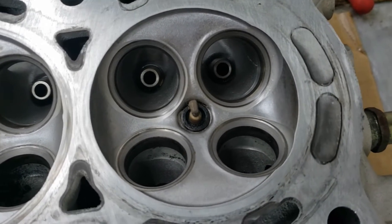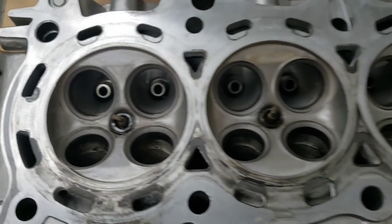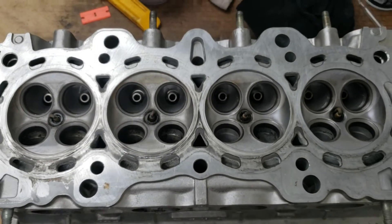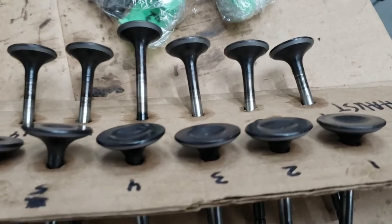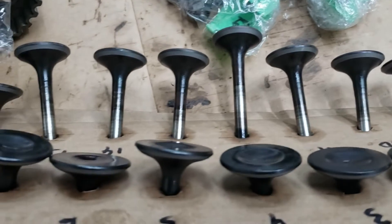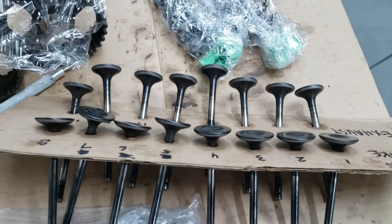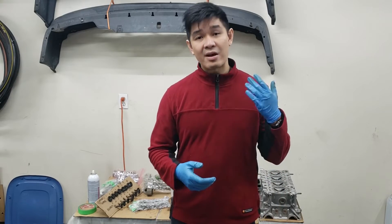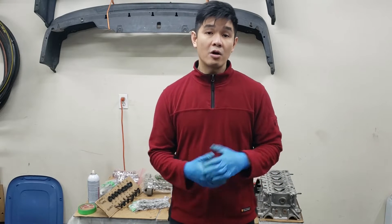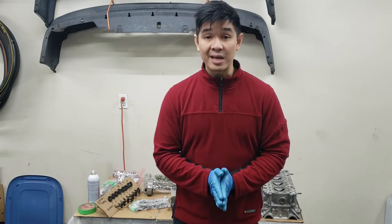All the surfaces are all lapped now. As you can see, all of them have that gray ring and they're all sealing up good. We've done the kerosene test. Here are all the valves — they all have the gray ring as well, all nice and clean. All that's left is reassembly. The valve seats and valves are all sealing up good with no more carbon. Next I'll clean everything with some brake cleaner and then start reassembly of the head.